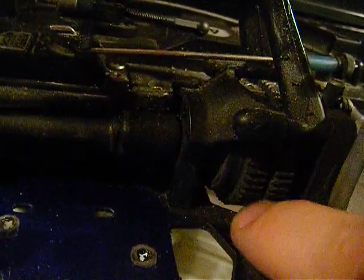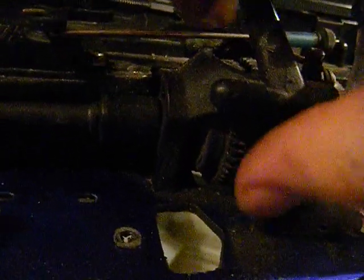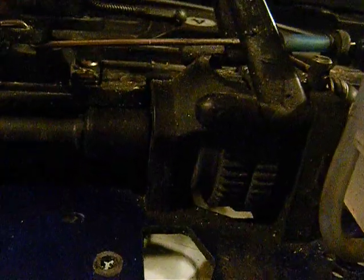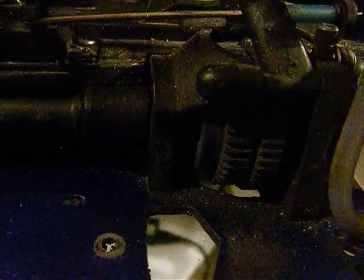With a one-way, as this speeds up, there's a clutch on this second gear that spins freely. When that expands out, the gear ratio changes and this one gets engaged. So at second speed you'll hear the engine rev down and start revving back up. You have your brakes, you have your servo controls.